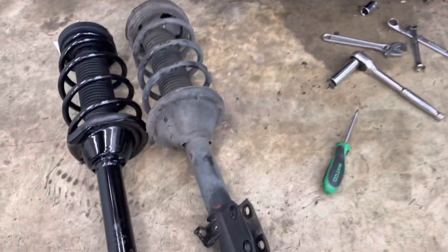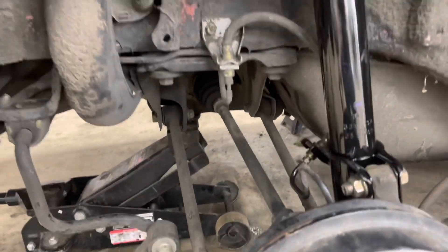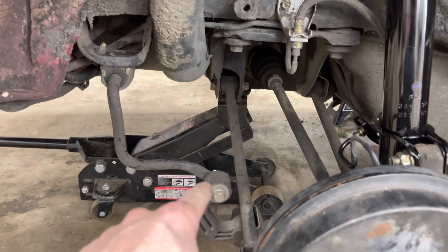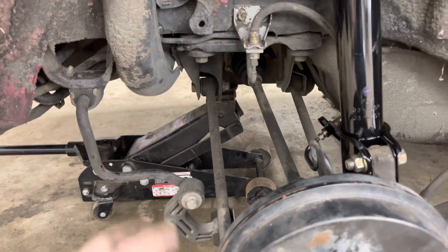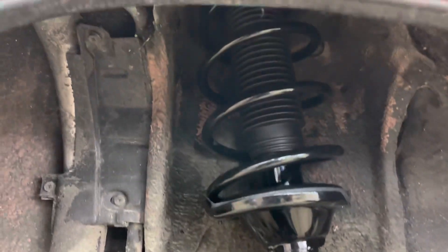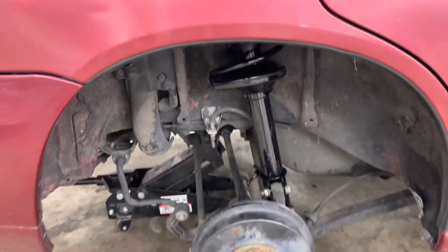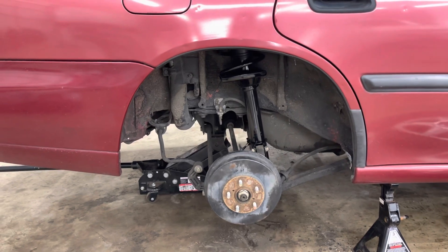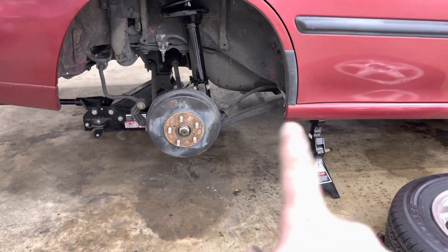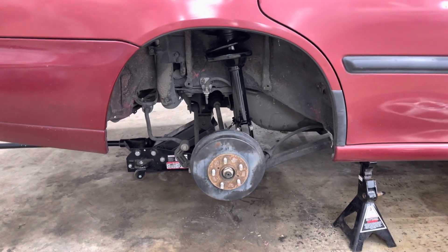So now it is in. A couple notes: I did have to disconnect the upper part of the sway bar here, but it was pretty straightforward and easy. Sits in there just right. It's out of a 2004 — that's what these struts are for. Everything matched up up top, bolted right up. If you look at it, it does kind of have an angle to it. I might need to get some extended arms here at some point — I'll definitely look into that.